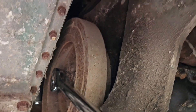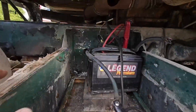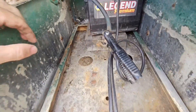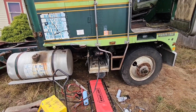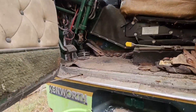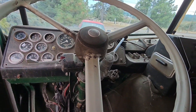I hit it again and it won't roll over after that, but I put a bar on it — and you know what, this thing rolls. It moved a little bit. So I replaced the cab power wire, put the battery in on the other terminals. I don't have enough juice to kick it over fully, but it cranks a little. I'm going to get the bigger battery — I'm more curious if it rolls over than anything. We just need more amps.